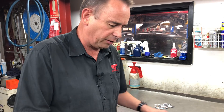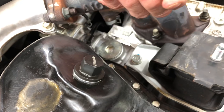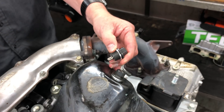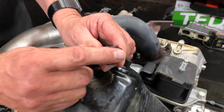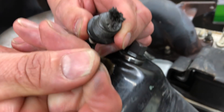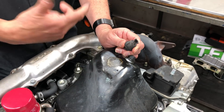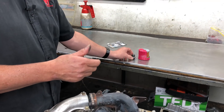The other thing I want to talk about — you'll notice this engine, since we've been looking after it with Whiteline, has got a great magnetic sump plug. Inside there is a really highly powerful neodymium magnet. When it's screwed in, this part of the magnet is exposed to the oil sitting in the sump. Typically, depending on the wear and tear on your engine, it may come out actually looking like this. What you can see on the end is lots of little bits of metallic particles which looks like fur — it's actually gritty magnetic wear-and-tear particles out of the engine that are in suspension in the oil when the engine is operating. Because of the magnetic sump plug, as the oil settles or is circulated through the engine, it's attracted to the magnet.